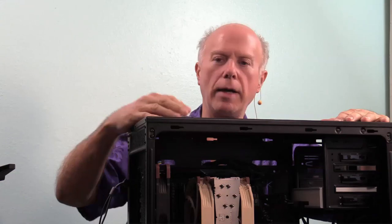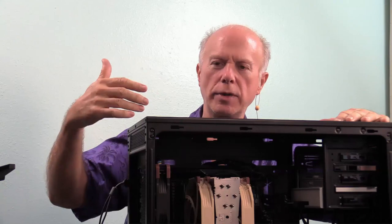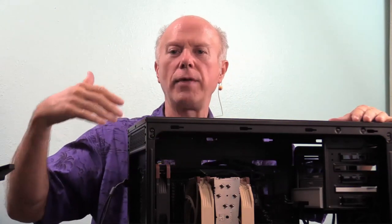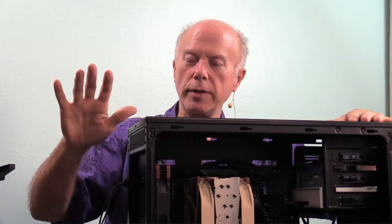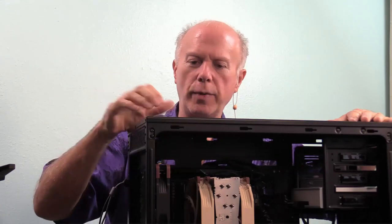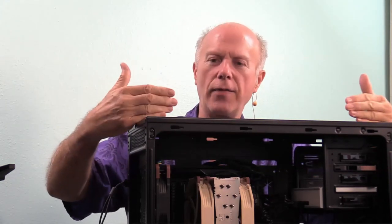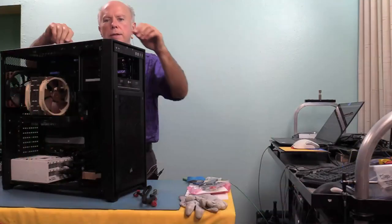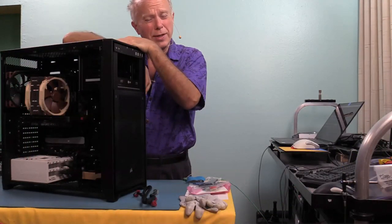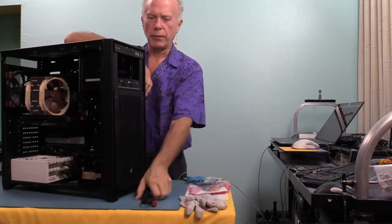At this point while we're at it, once we're doing this extra configuration and stepping through this - remember we're still going through the power on self-test, the smoke test. We're still checking the integration of the system to make sure we have full functionality. In other words, when you build, keep it simple - always remember that. We're building on that foundation so if at any point we have an issue, we'll know at what point to stop and solve it. If you build everything into the computer at the beginning and have a problem later, you're left trying to figure out what happened.